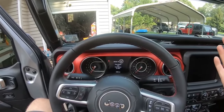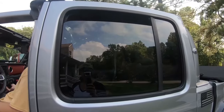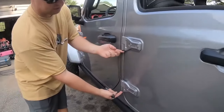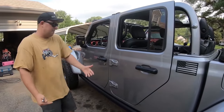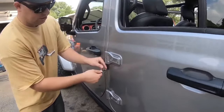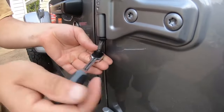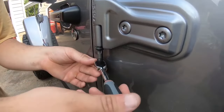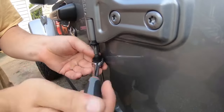First thing we do in prep of removing our doors is roll all four windows completely down. The first thing I like to do is remove all these screws on the door — I take these off and leave them off pretty much forever. A lot of people will go and put them back on; I don't see the point. We're going to grab the same tool we just used to remove our hard top and remove all of these bolts. There are eight of them total — four times two. Now be very careful that you're not scratching your paint when you do this; I just put a finger behind it.